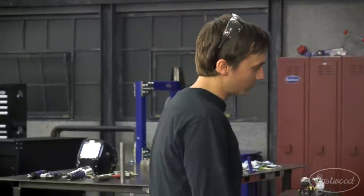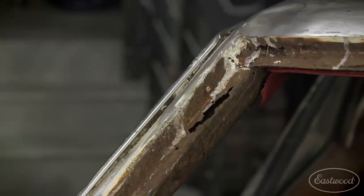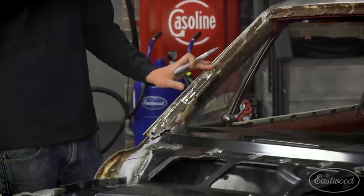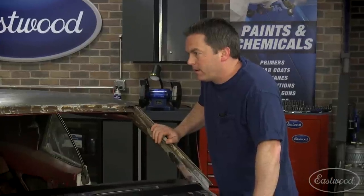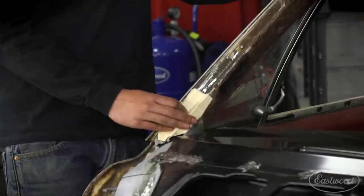So what's next? Now I'm working on a little A-pillar patch right here where the windshield channel is. I got some rot there — some rot on the top third. Hoping I can salvage this middle piece and kind of just make some little templates here and here. If it turns out I can't weld anything or attach any metal there, I'm gonna have to cut this all out and start from scratch.